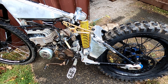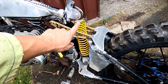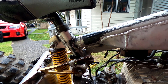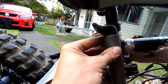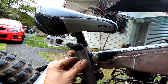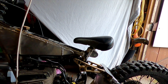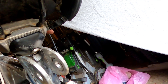The dampening works really good as you can see, but the spring's too soft - I can bottom it out too easily. I can put a packer in the spring or another spring in there, so I'm pretty happy. Next I'm gonna blank this hole off since I'm filling it up over there. I'll chop off this stem and make it as low as I can against that bracket so I can have the seat low - a low seat like a jump bike gives you more maneuverability, and I only need the seat up to pedal, which I don't need to do.